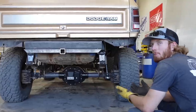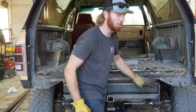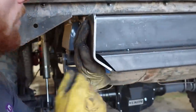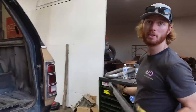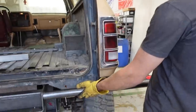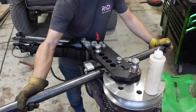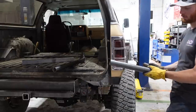Good and strong — I want it to be something you can hang the entire vehicle off of. The main structural part of the bumper is complete. We just have to tie it in better, so I built these plates to go on the end here — they'll get welded to the edge of the bumper and then bolted to the frame so we can still pull it off. Next, the round bar is going to wrap around the side like that. I've got my first mark here for the tube bender, and I want it angling up slightly.